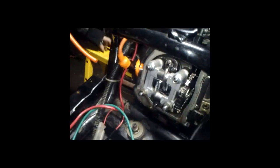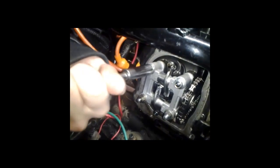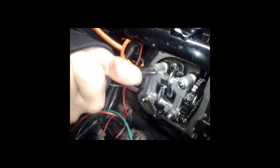Okay, so in order to take that off, of course, you're going to need a 10mm. This is 10mm to the right on the side. It's metric, of course. Japanese, so what you do is you take your 10 here and just loosen them up. Don't loosen them all up side to side. You just take it diagonal. And that popped because that was tight. If it pops, it was a tight seal. Alright, I'll get back to you after I get it off.